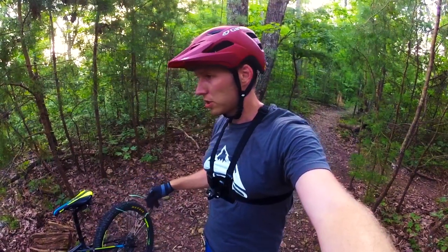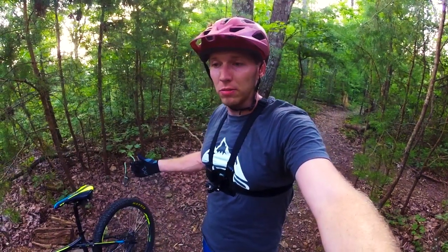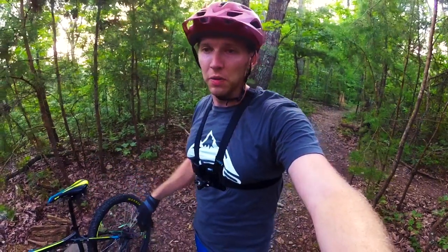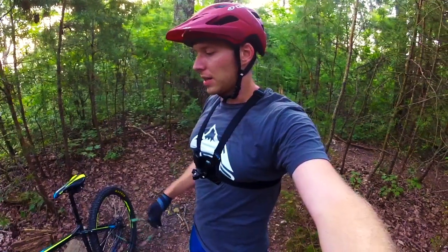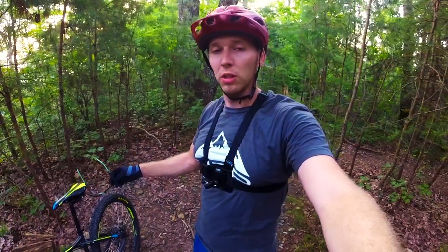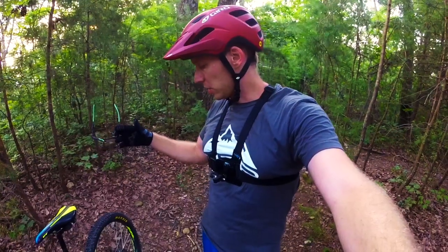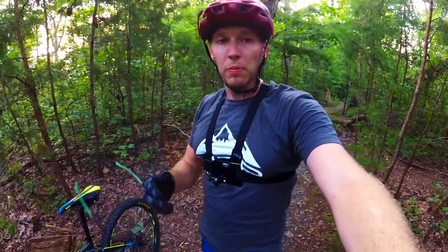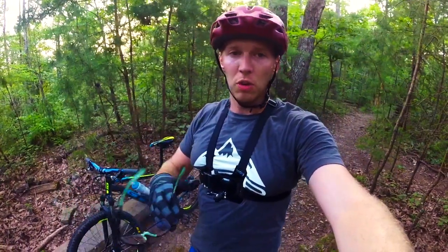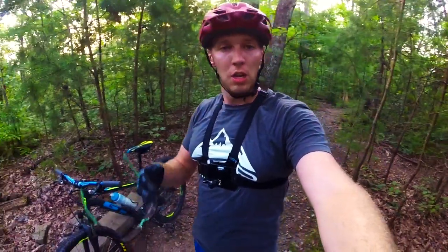I'm going to check the pressure of the tire throughout the ride and make sure everything's good. With the new air liner, it shows that you can actually run flat on it. I obviously don't promote that, but they just show the capabilities of it, and it's been tested for it. Not that we're going to even try to get that far. But if the tire pressure runs low, that's what it's there for. It allows lower air pressure and better grip on the trail, because the tire's still pliable. But it also gives good tire protection, sidewall protection as you come around turns, and protects the sidewall to prevent tire roll too. So excited to try it out, and let you guys know how it goes throughout the ride.